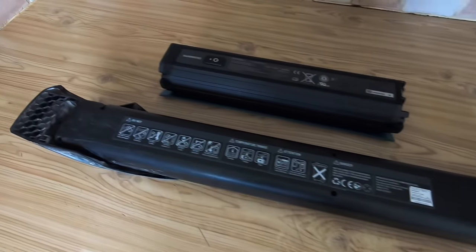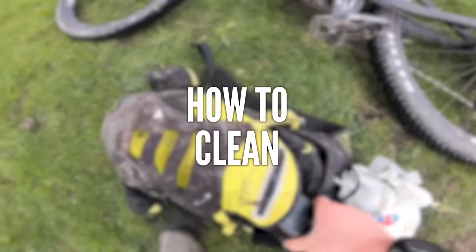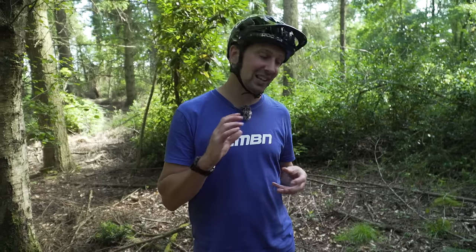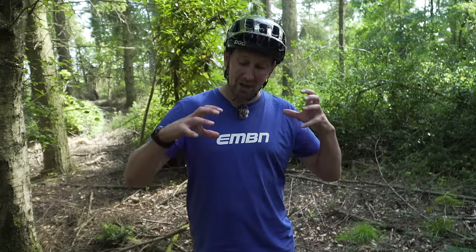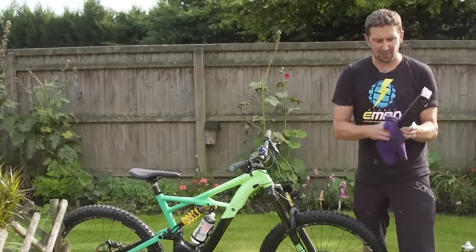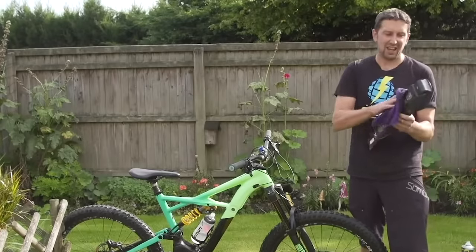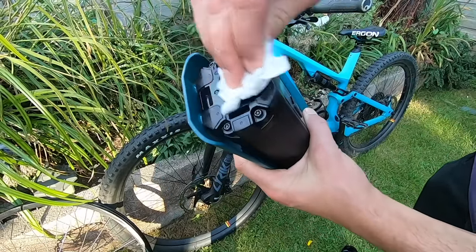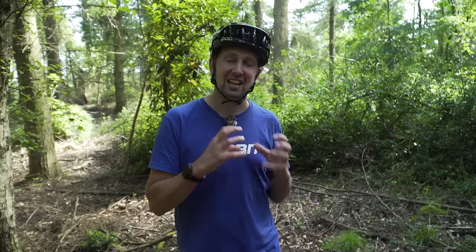Think about your batteries — would you like to sleep in your fridge for a week? When it comes to cleaning your e-bike battery, it's definitely a good idea. Your e-bike battery is one of the most waterproof components on the bike; some manufacturers give their battery an IP67 rating, meaning it can be submerged up to around a meter underwater with no apparent damage. That said, just apply a damp cloth to the outer housing and wipe it around. Pay attention to the contacts — spray a little contact cleaner in there to remove any moisture, and you can also add a little dielectric grease to ensure the contact is nice and secure.